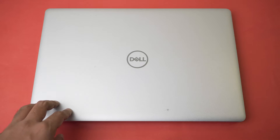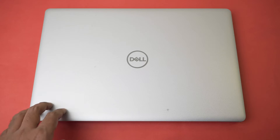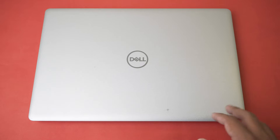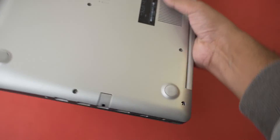But in my case the laptop fan is still making noise because I think the bearing is loose and it needs to be changed. I have already cleaned it but the problem persists, so it means I need to change the fan of my laptop.